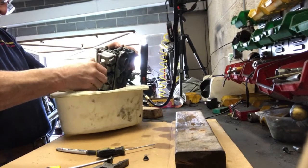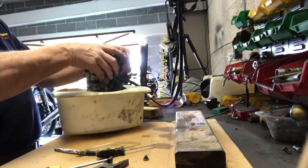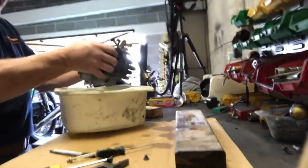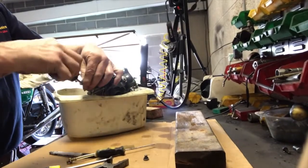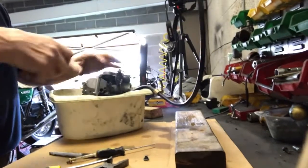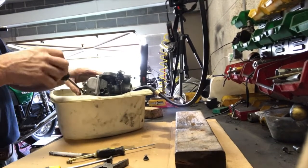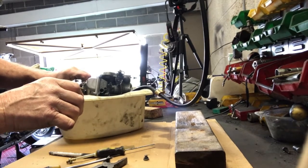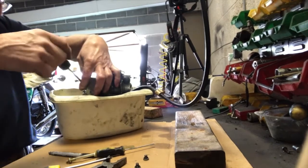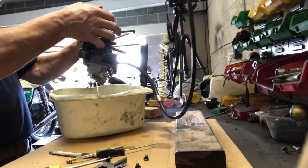Whilst I've measured them one after the other, I'm going to adjust them one at a time. I'm going to have to drain the bank, otherwise it ends up tremendously messy. This is one of the few things I use gloves for all the time when I'm working — whenever I remember. I should wear them all the time but I tend to forget now and again. By the time you've remembered you're not wearing them and you're in such a state, it's hardly worth putting them back on. This operation just gets so messy because you're filling and emptying the carbs all the time.